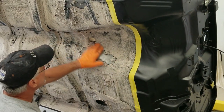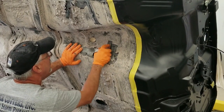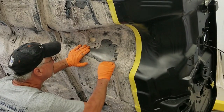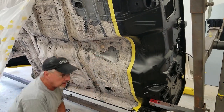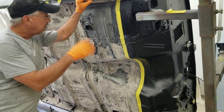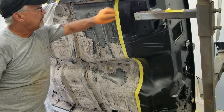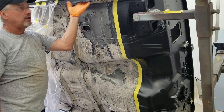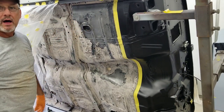And you got a nice clean surface to start with, other than, you know, I don't know what this undercoating and stuff is that they used on it, but it peels off pretty easy, and you're right down to the metal, and you can start scuffing it down and getting ready to put your epoxy on it, prime it, and you're basically almost ready to paint it. You put that underhood black on it, and man, this car looks beautiful on the bottom once you get all the lines hung and everything under it. We use, depending on what type of lines, it really brightens up the bottom.